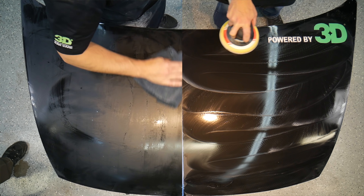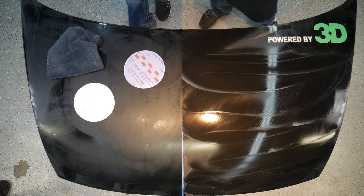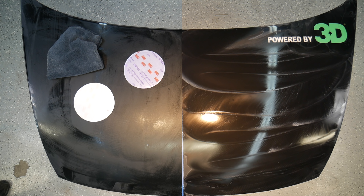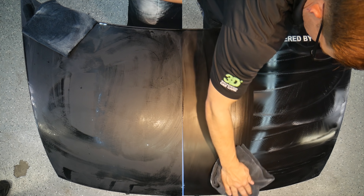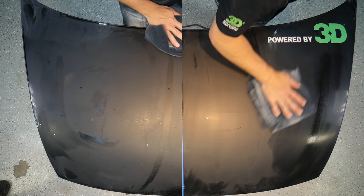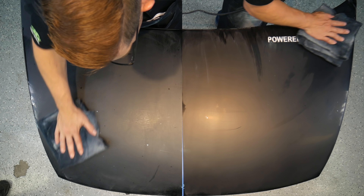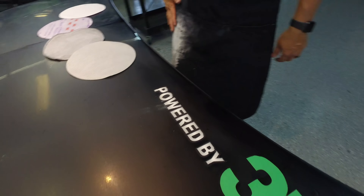We're going to wipe that down. A lot of water was left over on that 3M paper, and that was partially because it's not designed to be a wet paper. With the 3D paper, you'll see it gives you a nice, flat, even cut. Why is that beneficial? Because when it comes down to polishing, using the right sandpaper is going to help speed that process up. You can see that it almost started to polish, not just cut. You can see the difference in the line there between the two papers.